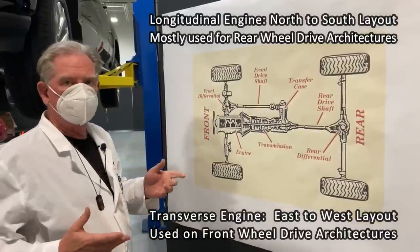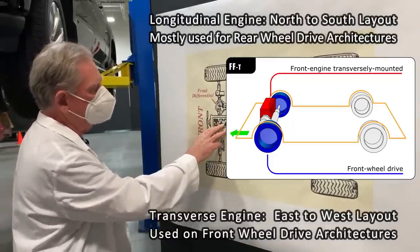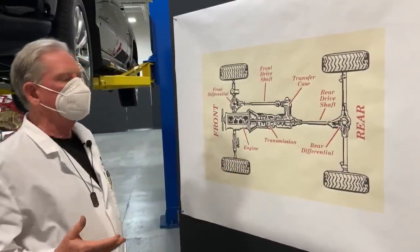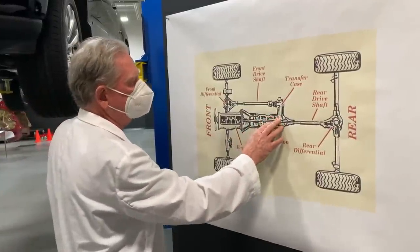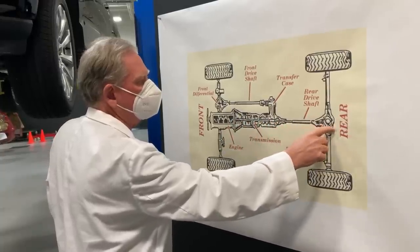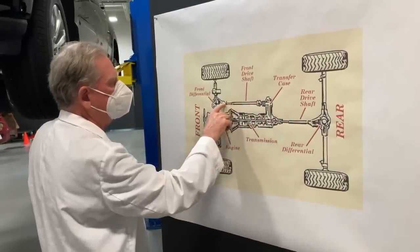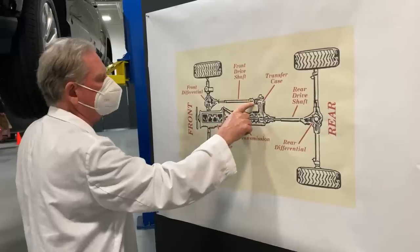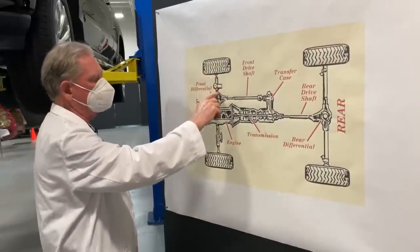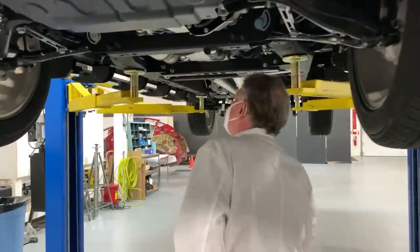Here's the engine — this is a longitudinal engine, meaning it's oriented north-south. Most of you driving a conventional small car would have an east-west powertrain, but this is north-south. The engine is connected to the transmission, which is then connected to a transfer case. The transfer case is sometimes called the quarterback of the powertrain. It can be engaged and disengaged — power always goes back to the rear differential through a prop shaft, and the front prop shaft can be turned on and off, feeding the front differential to distribute power to the wheels.